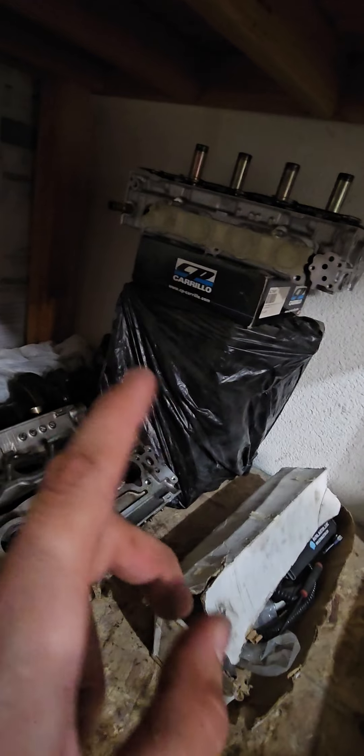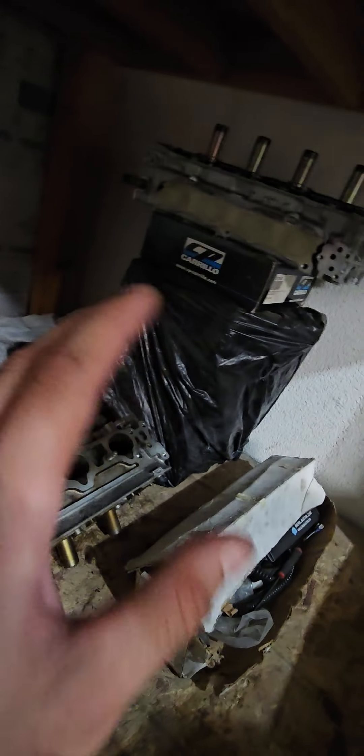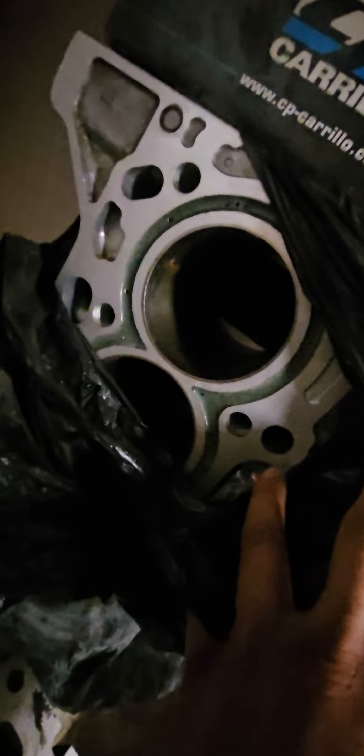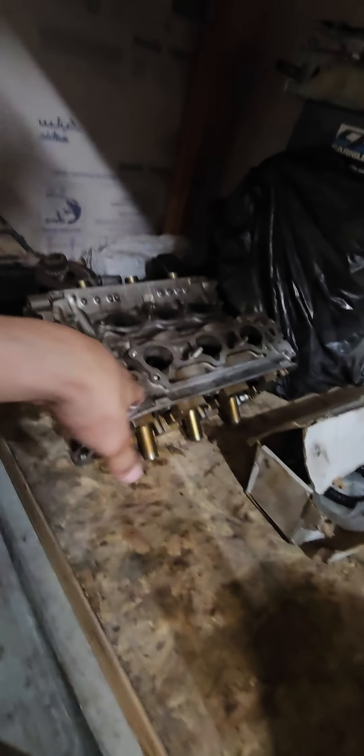This right here is a K20 built PPA head with pistons — that's for a future build of mine. I probably want to put this into a sand rail or something. It's going to be a turbo build. I did epoxy fill this one — there's a video on my channel explaining it. This is a K20 87mm PPA head with VTEC killer and the full head package.